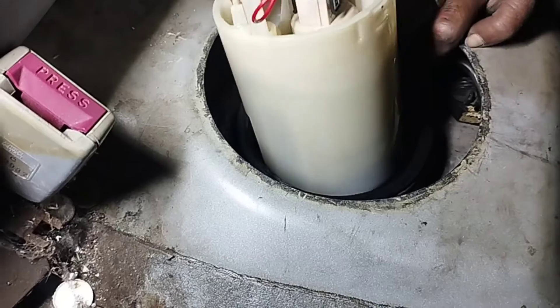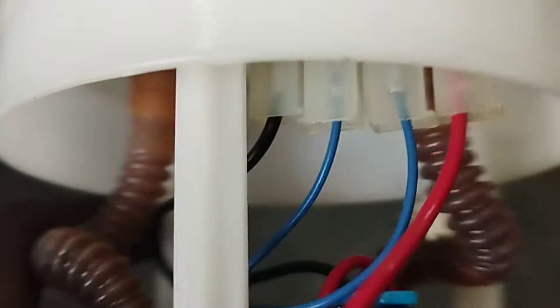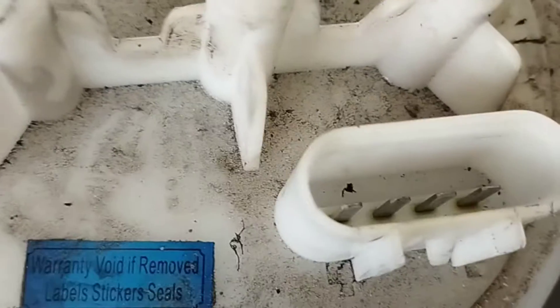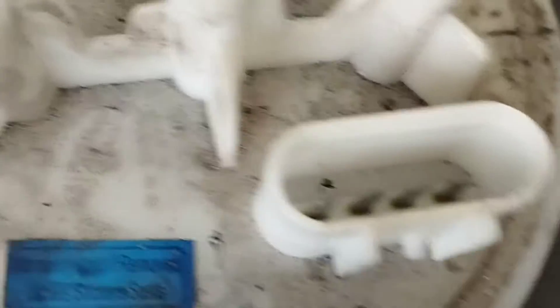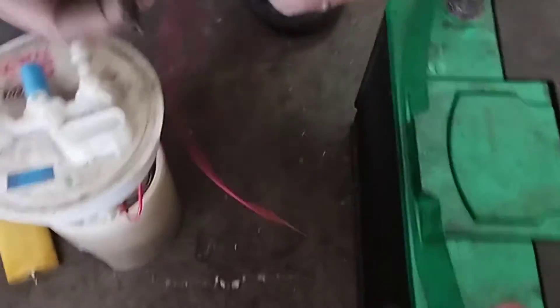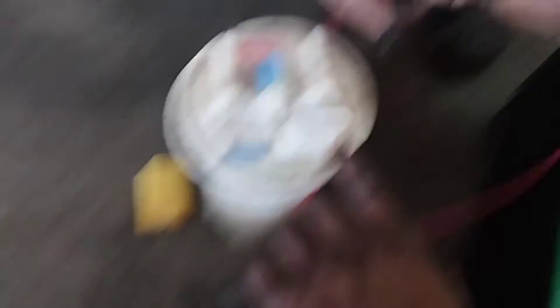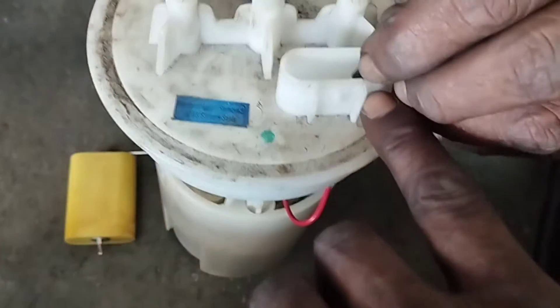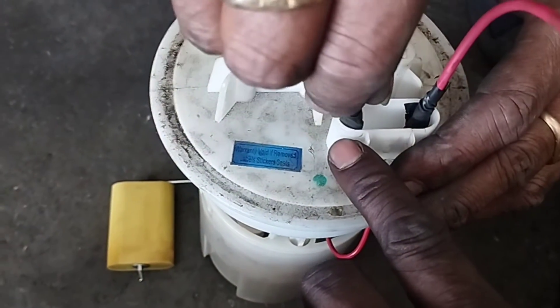Open the fuel pump and take out the wires of the fuel pump motor. The red wire is the positive supply voltage and the black wire is the negative body earth signal. From the right side of the fuel pump wire socket, pin number 1 is the positive supply voltage line and pin number 4 is the negative supply voltage signal. A 12-volt battery and two wires are required to test the fuel pump — connect the two wires to pin number 1 and pin number 4 of the upper socket of the fuel pump.